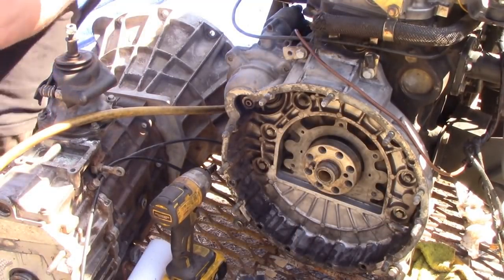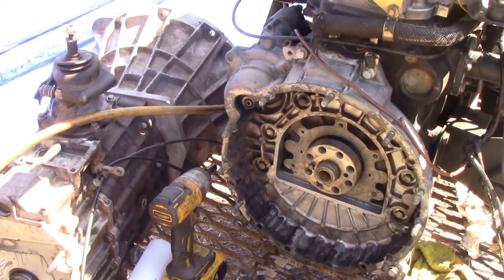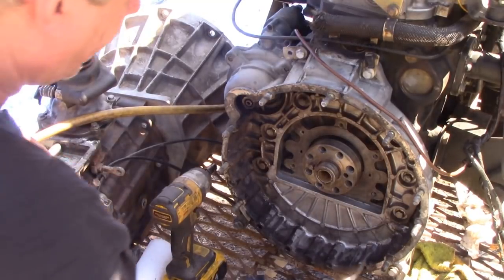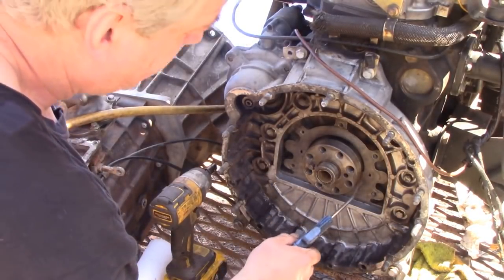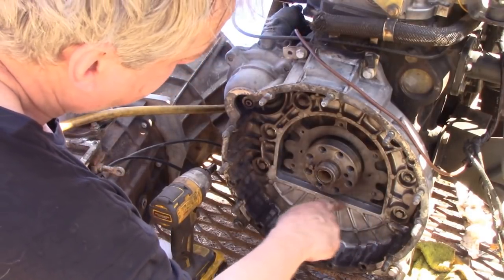So we'll hang on to that tool there for the clutch. Next thing, we might as well put the seal on, eh? And then it'll give it time to dry. Check out that little hole on the side. Yep, we've got that one. Do we blow it out? Yep. We're going to fill those up with a bit of RTV prior to putting the seal on.